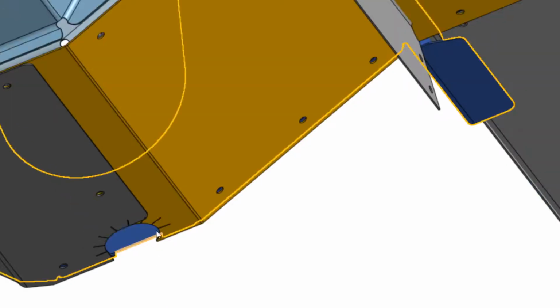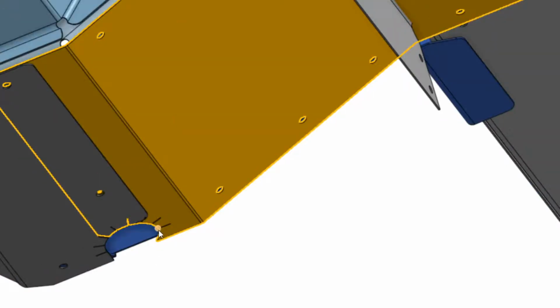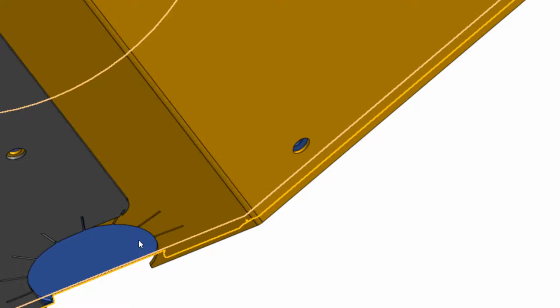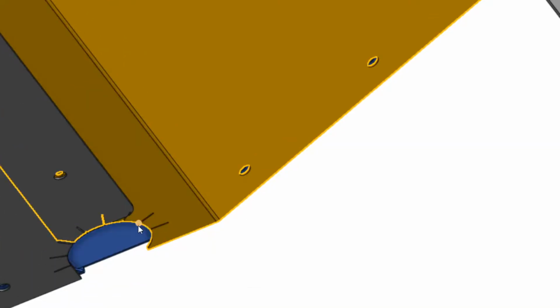There's a partial cutout here to fit around the oil return line from the turbocharger bearing, and just like the line going in, it has fingers cut in it so that you can adjust the size a little bit with those fingers if necessary. You can also bend them. In this case, you're going to bend them down so that they parallel that line rather than potentially abrade that line. So just like the other one, bend them so that they have smooth contact if they make any contact with that line, and try to give yourself a little bit of clearance all the way around that oil line.